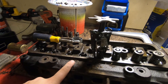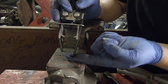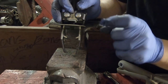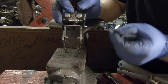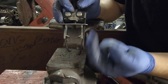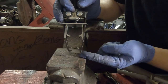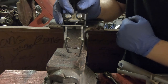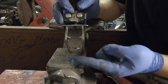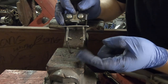These two I was able to use after modifying the tool just a little bit. The tool breaks down into two sections: you've got the teeth down here that grab the spring and then the teeth right here that mash down on the top of the retainer so you can get the clips out with a magnet. The slots were flat out of the box and any time you put pressure on they'd just basically spring out and come off the spring.